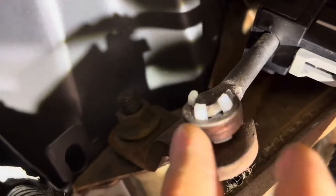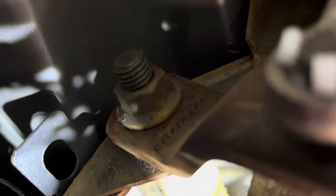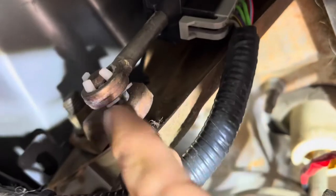So today we're going to come in here. You can see right up here there's that nut — it's an 18 millimeter. You just undo that and then put a screwdriver between this bent bracket and the whole clutch and brake mounting bracket. Once you get that nut off, you can pry this bent bracket off and then replace it with the part I had. Just pop this retainer clip off, move it out of the way, and undo that nut.